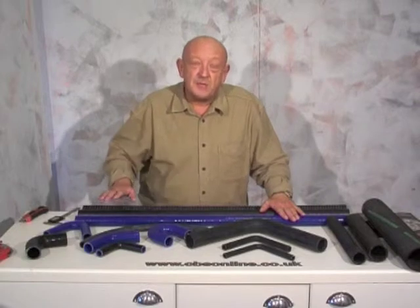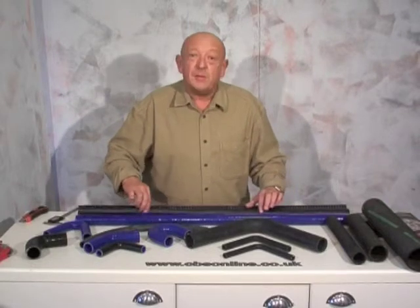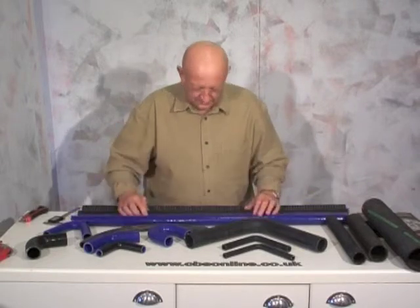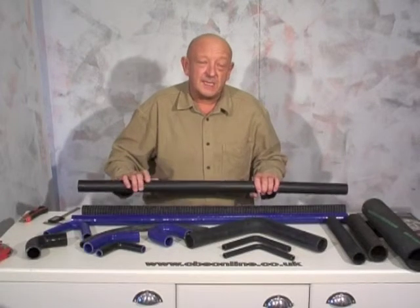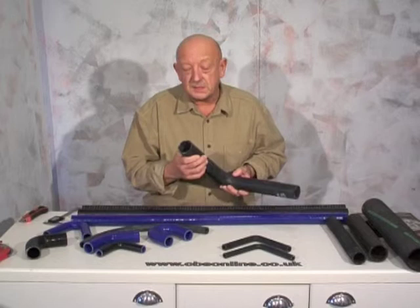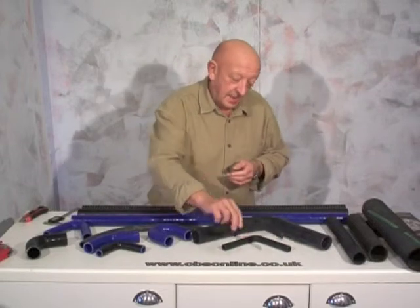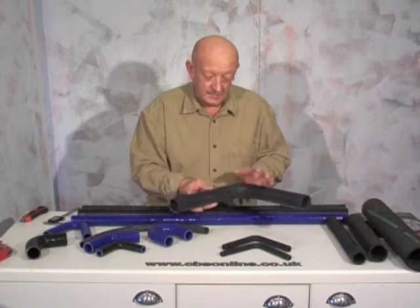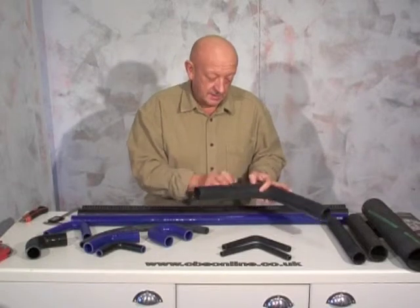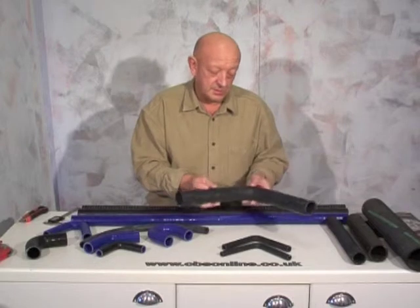You can find everything you need from our range of hoses and joiners. There are basically two types of hose available for plumbing the cooling system of a car: rubber hoses and silicon hoses. Rubber hoses are available in straight lengths of a meter or in 90-degree bends, from large sizes like 60mm ID right down to 10mm ID. If you only want a short length of straight hose, it may be more economical to buy a 90-degree bend — for this 50mm one, for example, you've got a good 10 inches or 200mm of straight hose. You can just cut it off, or you can shorten down a large bend to a small one.